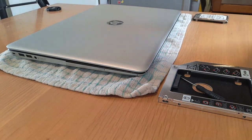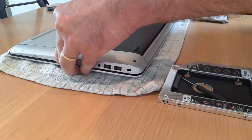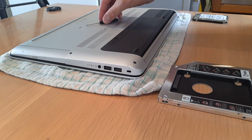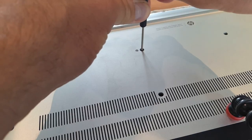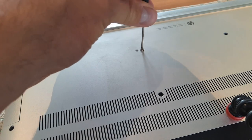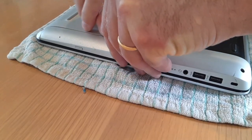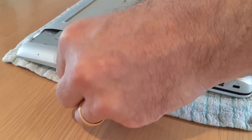With the hardware ready, the disk drive empty and your laptop powered off, remove the battery if possible. Put the computer lid down on a towel on your table or work area to protect from scratches. Identify the DVD drive and its locking mechanism. This might be a catch or a screw accompanied by a small disk symbol. Remove this and gently push out the drive with your fingernails or a plastic knife or a store card.